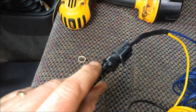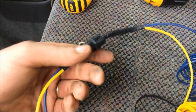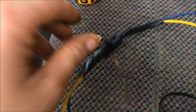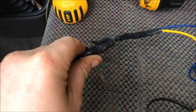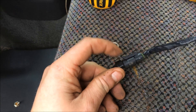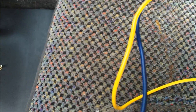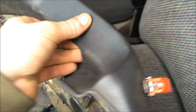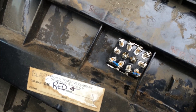This is the plug here for the coolant temperature sensor. I've got blue and yellow, and I've done these connections so that the blue goes to the blue and vice versa. This is a factory plug. All of the part numbers for the pins and the plugs are on my Google Plus page that I made for this. There are lots of different ways you can do it — the wiring diagrams are on there. I'm doing this to a single toggle switch so that when it's flipped, the air intake sensor thinks that it's below freezing and the coolant temperature sensor thinks that it's below as well. So this will be a forced high idle.